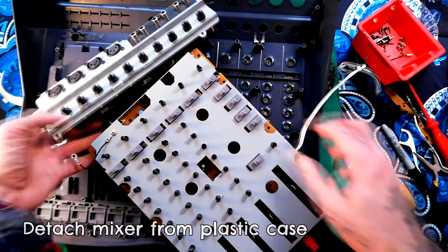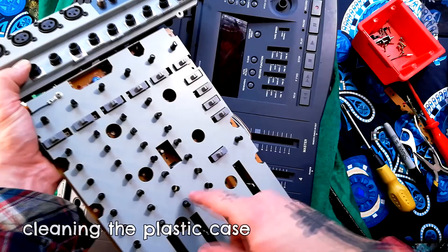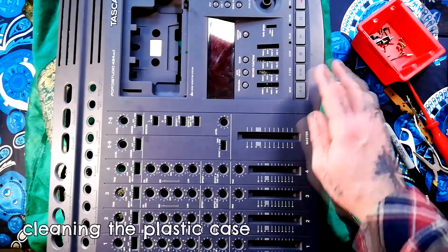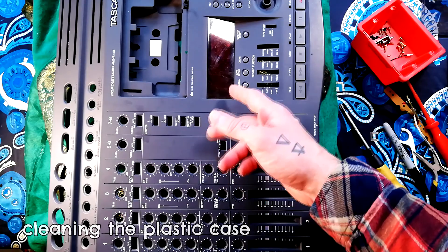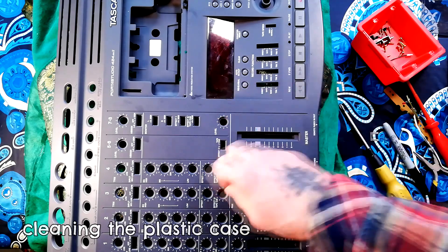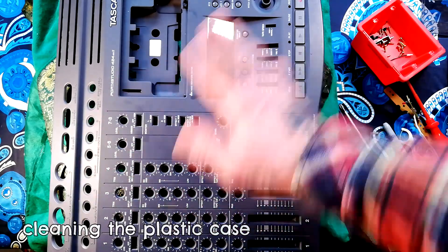This now comes away. At that point we're done with the plastic case. If you're going to remove the mixer for repair or cleaning anyway, that's probably the easiest state in which to clean the plastic. My process would be to lay it on newspaper, spray with Windex, and if you had a large enough plastic basin you could use a scrubbing brush with a little bit of detergent. Leave it to dry — a hair dryer on low heat can help blow air out of the crevices.